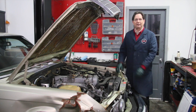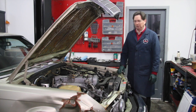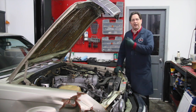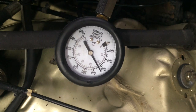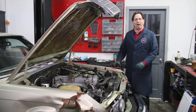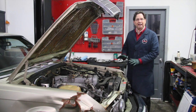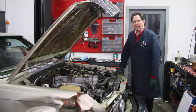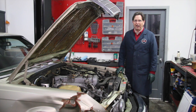When the intake valves get tight, they'll get to the point where they actually hold the valve off the seat, and then you'll have low compression and hard starting. That's why I always do a valve adjustment before doing a compression test. We put the compression test on and went through all five cylinders. I would expect an engine with 120,000 miles that's been properly maintained to be showing around 380 to maybe 400 pounds on each cylinder, but this one came in at around 340 - I had one at 345, one at 330. You can see here they're not jumping up real quick.